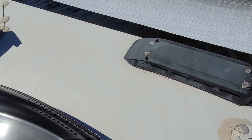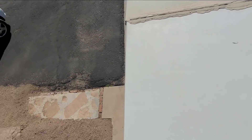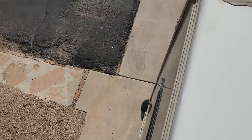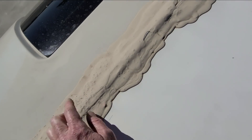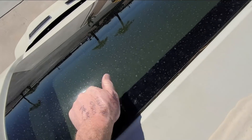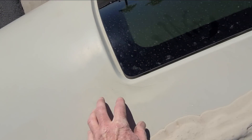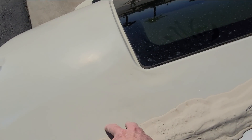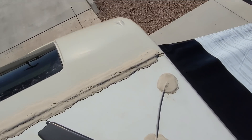Let's take a look at the AC — we'll make sure it's not loose just by leaning up against it a little bit. This thing is holding up fantastic. This weird bubbling right here is because this isn't Dicor roof sealant, it's a different brand — I've noticed that acrylic has a little more bubbles in it, but it works just fine. That's actually frameless glass right there. There's a little stress crack — that's just cosmetic in the gel coat. I'd keep track of that. This is fiberglass, so you could do bodywork and paint it, but really you should wax this — it needs to be waxed or it will oxidize.